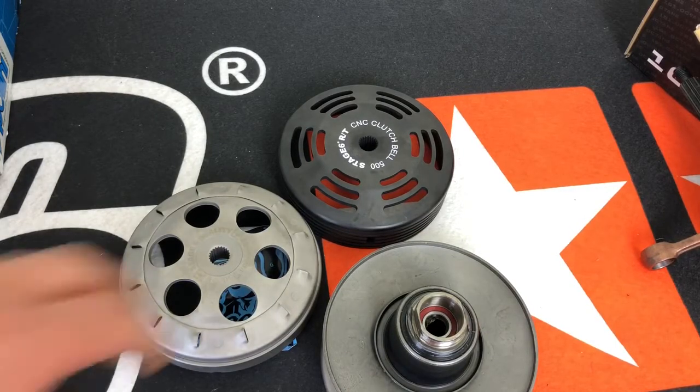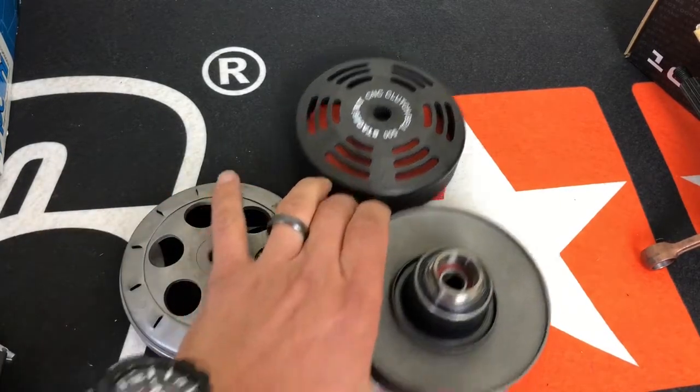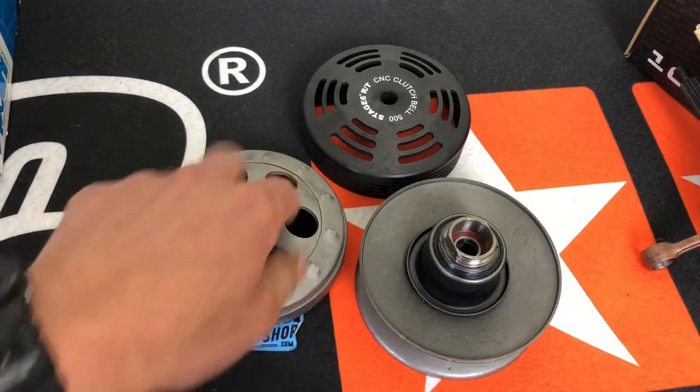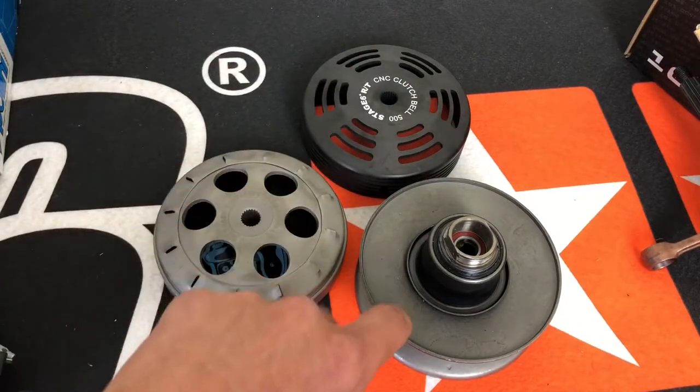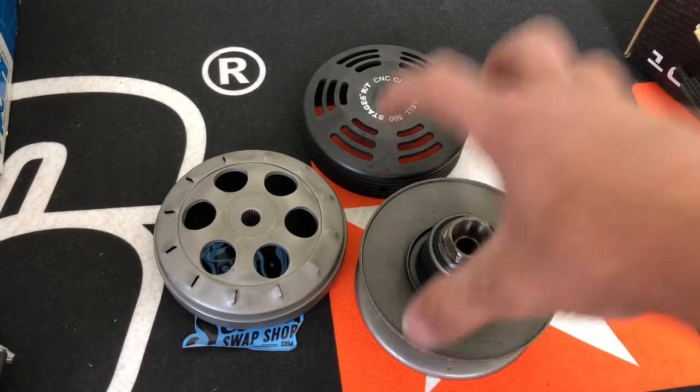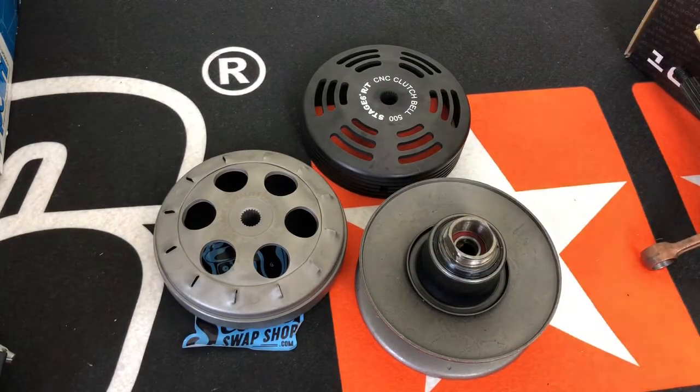This will pertain to other bikes as well. But if you're having issues getting your front belt to travel up all the way on the variator, this is something to check to make sure it's opening up all the way. It doesn't take that long, and worst case you just put some shims in here to bring it further out — it's not that hard to do. So hopefully that helps you guys with some transmission tuning.